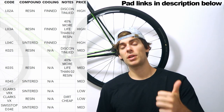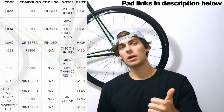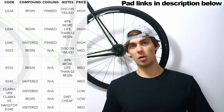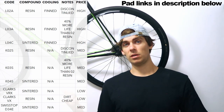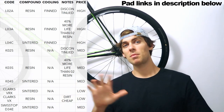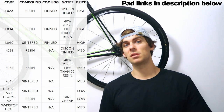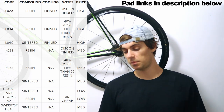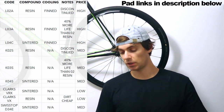Resin has a slightly higher friction coefficient, will wear out quicker, but is kinder to the disc. Sintered pads are fused metal powder-based compounds — they're much harder, longer lasting, but will chew up the disc slightly more, so you need to balance that out. They're probably a bit more consistent across dry and wet conditions. In my experience, resin pads in the wet are vastly different to how they perform in the dry, and actually next time we're going to try sintered.